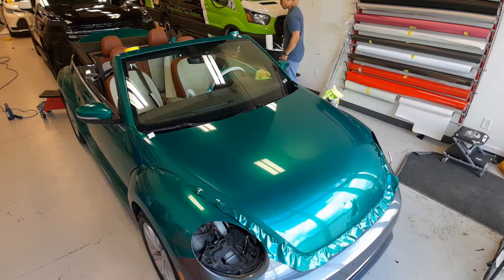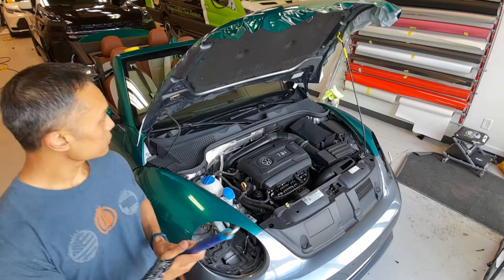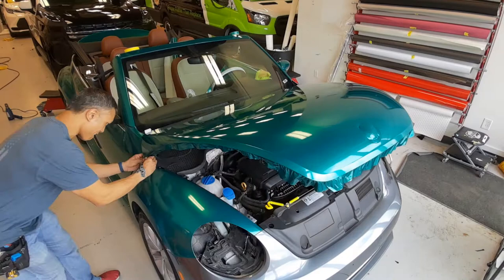Across the front I went ahead and cut off the excess vinyl. I'm going to use a hood prop rod that holds the hood up a little higher but not as high as the car's prop rod, and that just allows me to work the vinyl that's hanging over the edges a little bit better. I'm rolling it over each edge, making sure that everything's glassed out, has full coverage, and goes over the edges nicely so that when I trim it, it looks like paint.